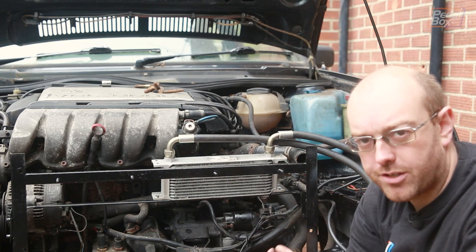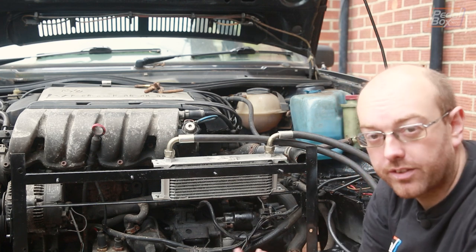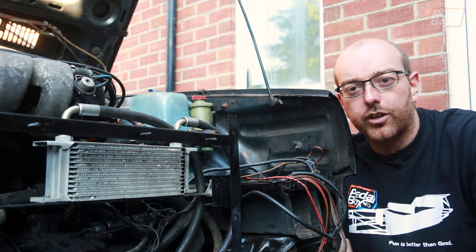I've remanufactured this bracket, and the oil cooler is sitting a little bit lower now, clearing the manifold. The pipes come around nicely down towards the oil cooler. So we need to start installing the sandwich plate, and that's not quite as simple as just unscrewing the cap and screwing a new one in.